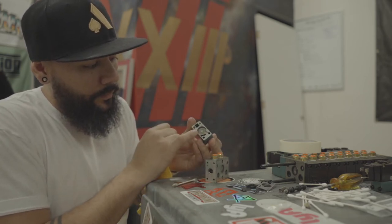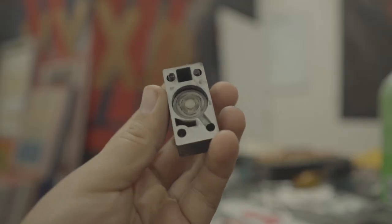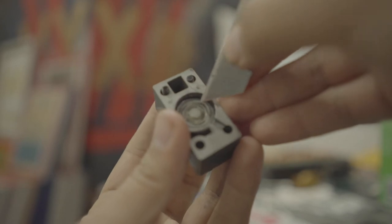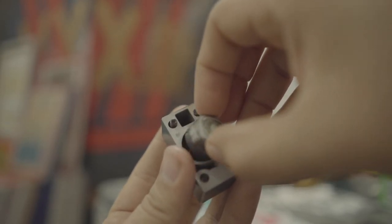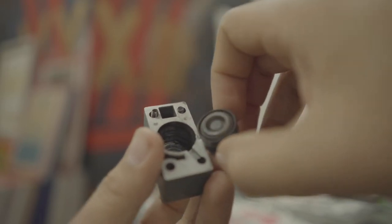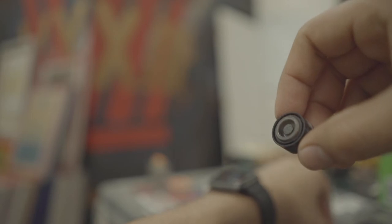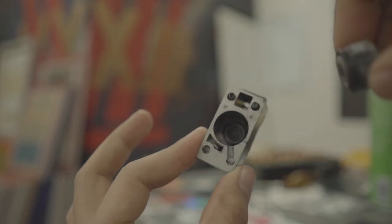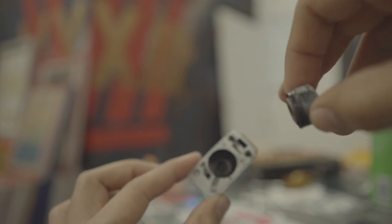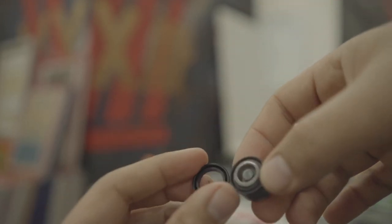I'm going to show you that cup seal inside so we can lubricate it and replace it. We're going to pull it out with a blade — you can use whatever you like. Right next to it we have that seal I was talking about, and it is very filthy. Just remember that the new cup seal has to go in the same exact way. When you take it out, note the orientation and put the new one back in just like that. We're going to clean this entire component just like I showed you with the 480, clean the gear, and then put the cup seal in exactly the same way.